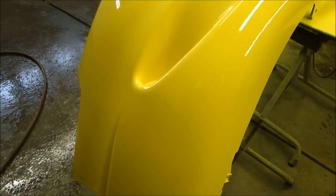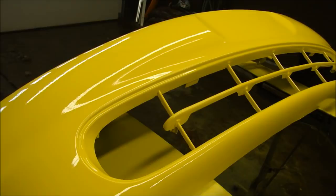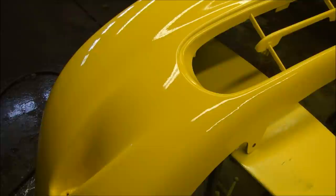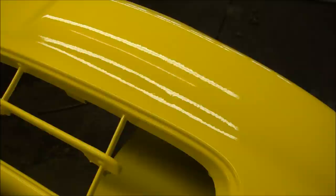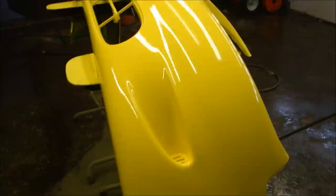One very light coat — I just about sprayed it on there. Since it's so cold in here, you can see my breath. You put it on and it's going to flow, so spray it light. Don't spray it heavy. Less is better when you're spraying clear. Then I'm going to take this into the shop area where it's warmer, let it warm up and wait until it tacks up, then I'll put another coat on and show you the tack test.